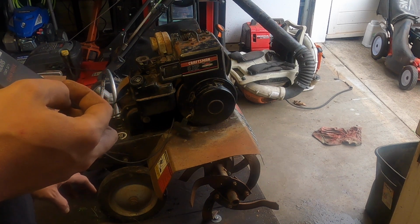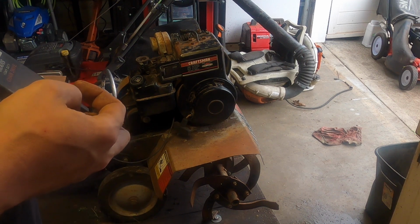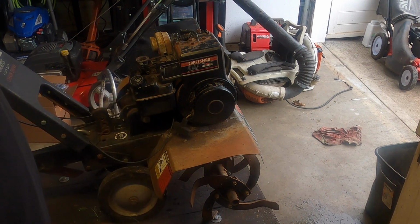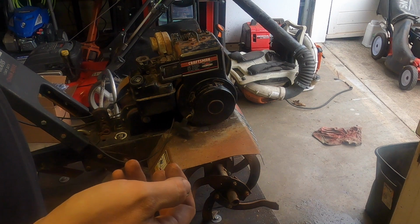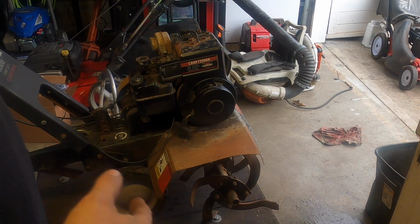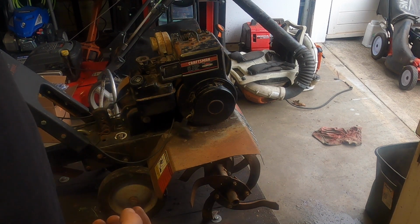I just want to say this is a good motor. So this is a good way to check your motor. If it's been only like a year and somehow there's just a little bit of fuel that got stuck, to be honest, it's probably okay to do this because fuel is going to be rushing over it anyway when you're using it, and fuel just kind of cleans it. Have you ever heard of those direct injection engines that have a whole bunch of carbon buildup on the intake because it's directly injecting into the cylinder because fuel isn't going behind the valve? This does, so it's going to clean it. Let's put a little starting fluid and see what happens.